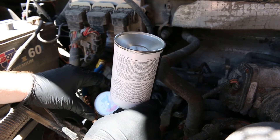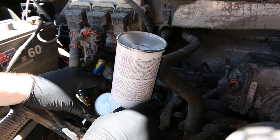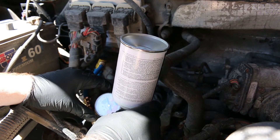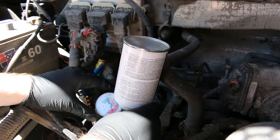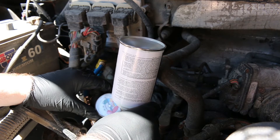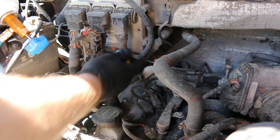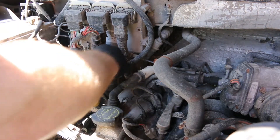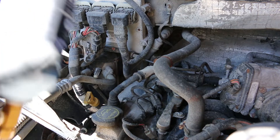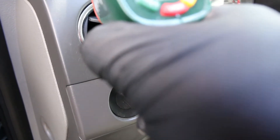She's drawn in now — you can see the pressure spiked momentarily. We're sucking in; you should feel the can getting lighter and lighter. The compressor is running solid now — we're not hitting the low-pressure cutout. Compressor is able to run solid because we're right in the blue zone. The can is now empty. Pull the connector off — just a little bit came out — and we're done. We can recycle the can and put the gauge away till next service.